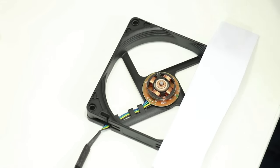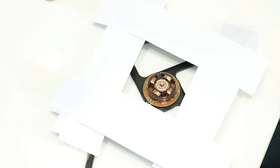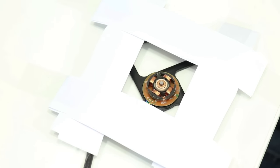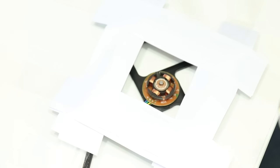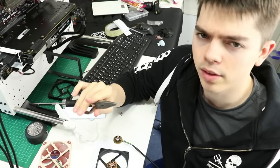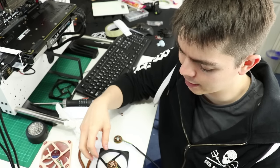To prevent the frame from lifting during the fix procedure, I taped it to the desk with a layer of paper to prevent the tape directly sticking to the frame. I started heating and pulling away with pliers and heat gloves, but that really didn't work as well as I'd wanted — I was pulling too much and not applying enough heat. I didn't want to put more heat through it as it might cause issues with the paint finish, or risk bending the spokes so the fan blades would be riding higher by a few millimetres, affecting airflow.